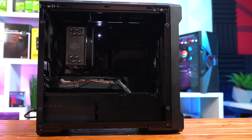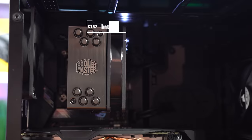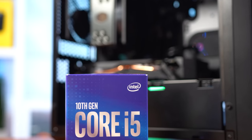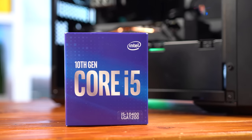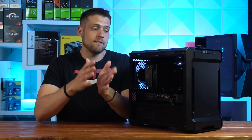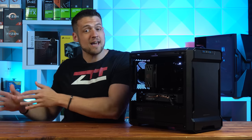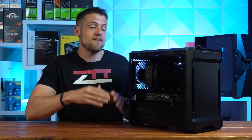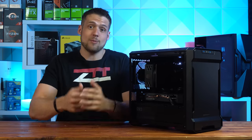With the more important stuff done, it's time to check out this all black gaming PC. Let's jump into the parts list with the CPU. This is actually my first new Intel CPU since my 8700K — this is the i5-10400. The 10400 is rocking 6 cores and 12 threads with a boost of up to 4.3GHz and I snagged it for $182. There's competition from Ryzen 5s at a lower price, or you could spend a bit more and get the unlocked 10600K, but I could not find a Ryzen 5 paired with an ITX combo for less than what I paid, so that's why I went with this one.